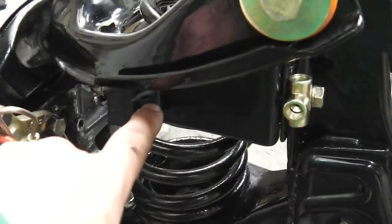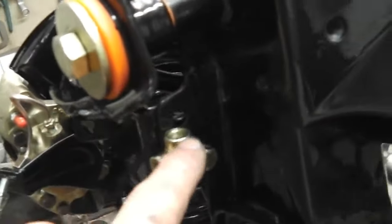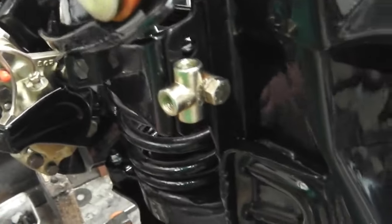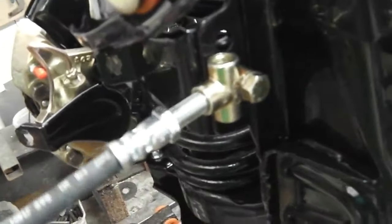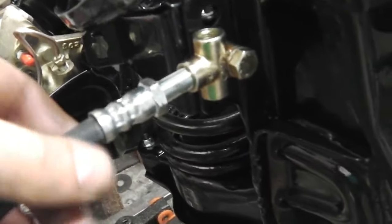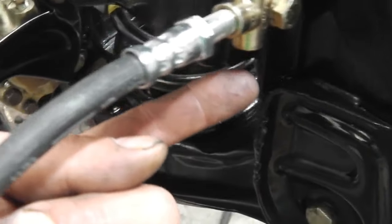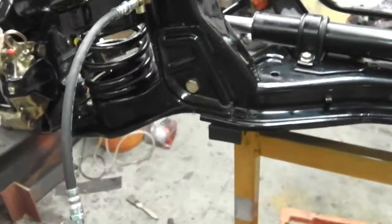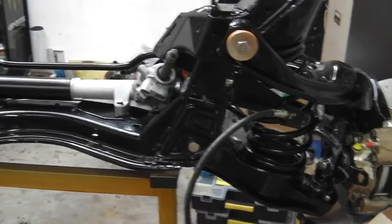But you would think that this one here would feed straight into the back of this rather than coming up, and you would think that that's the input in the top. But it has a flexi input which joins to the subframe, and they're showing that flexi input coming in to the front, so I guess I'm going to have to do it that way. I suppose I can see why they've done it this way at the bottom, because it could come straight out and link into that. It's probably easier to make the curve over the top. It won't make any difference physically, it'd be exactly the same distribution of pressure. It's just interesting why they've got two routes, one in real life and one in the book.